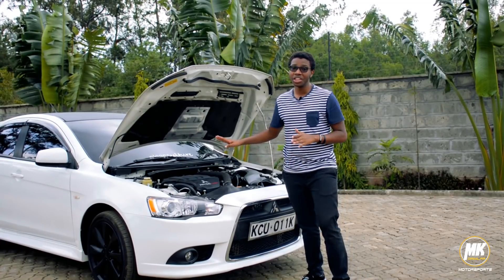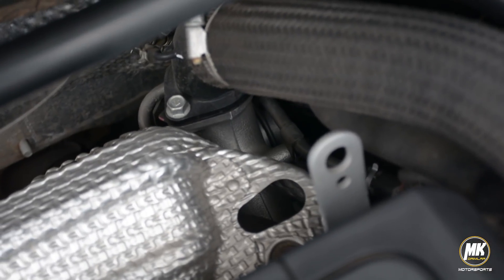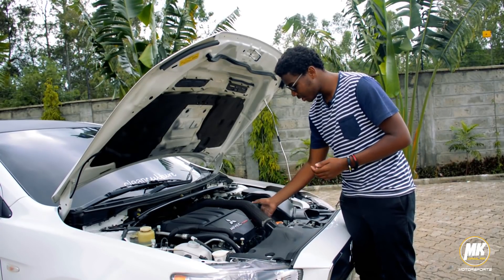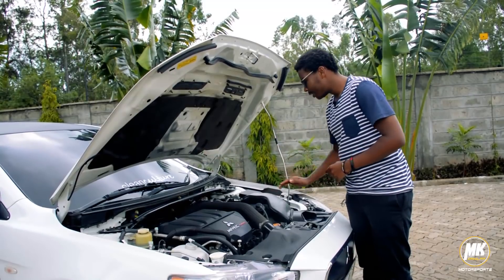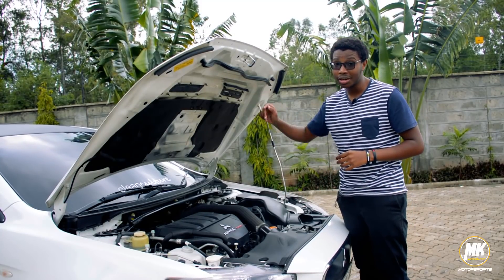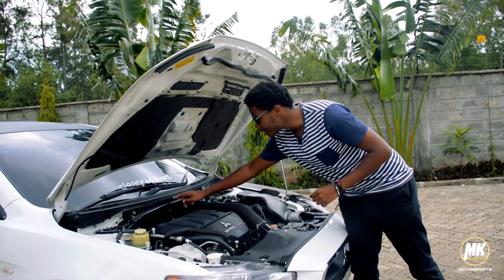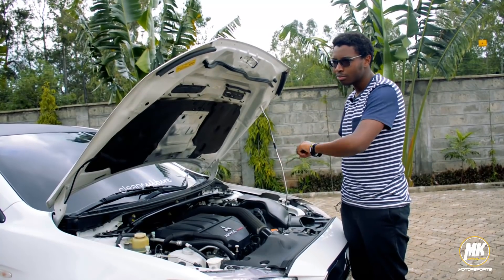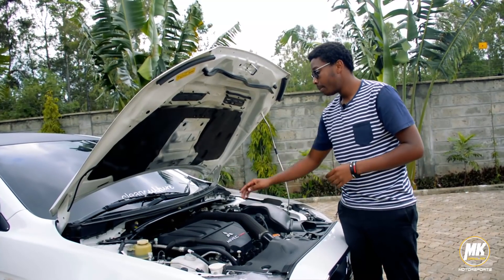The main differences come under the hood. The key difference between this and the Evo is the turbo: this has a single scroll turbo while the Evo has a twin scroll turbo. The turbo location is the same, but the intercooler pipelines on the Evo are aluminum whereas here it's a rubberized material. The bypass valve location differs — on the Evo it's at the rear of the engine — and the intake shape and size are also different. Another big difference: the Evo battery is actually in the trunk. Finally, the front strut bar on the Evo hooks into three different places and is more longitudinal, though the hooking points are still the same.